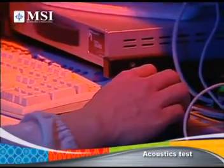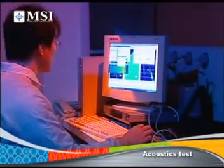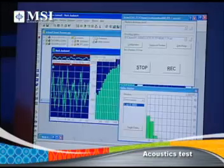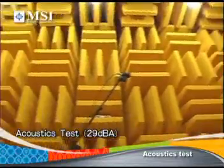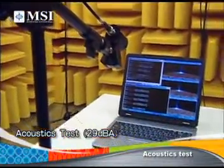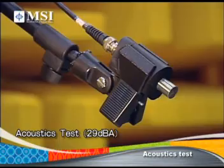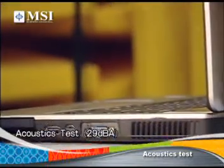To allow you to focus on your job in relative quiet, MSI tests for sounds that are likely to cause workplace disturbance. Complying with ISO 7779, which defines an environment that is quieter than a library or a hospital at 35 decibels, we use 29 decibels as the criterion to eliminate any prominent discrete tones.